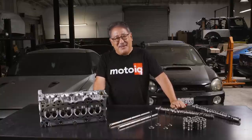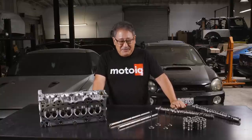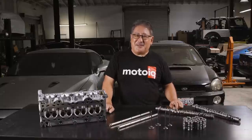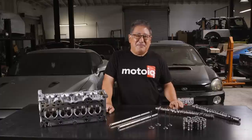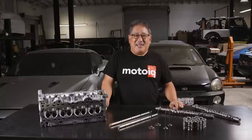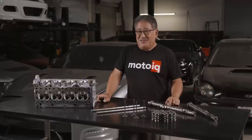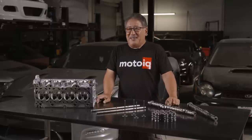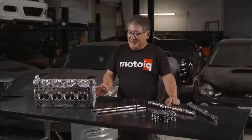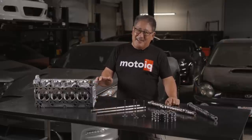If you want to go more, we have to get a little more fancy. This is a build we're doing for a customer — kind of a max daily driver, max effort 91-octane pump gas motor. This thing will put out probably 325 to 330 horsepower, depending on what header, exhaust, and air intake he's going to use. So we'll make anywhere from the high teens to low 30s in the horsepower range.